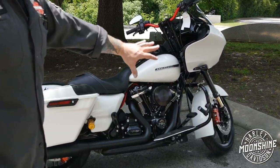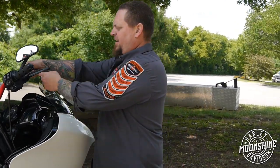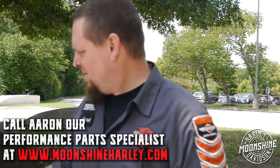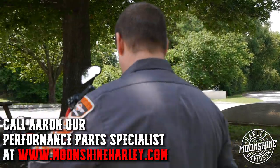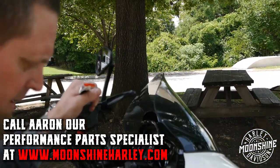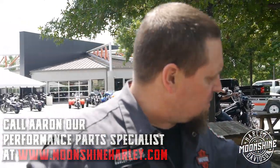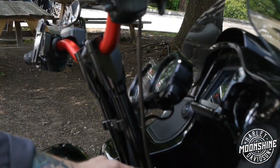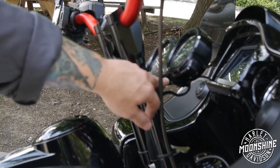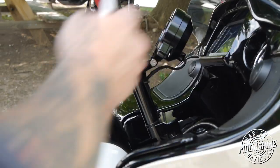Now we got it done. Let's go over the project now that it's finished so I can tell you, viewers of the YouTube, about all the different components we've got on here. We did the Krauss front end — we do a lot of these, they're featured in a couple of our other videos. One of the things this customer opted for is the straight risers instead of the pullbacks, so you have this spacer piece that pulls the riser back so you can get a straight-up kick, and you don't have to have the spacer in the dash or instrument cluster to run them in this configuration.